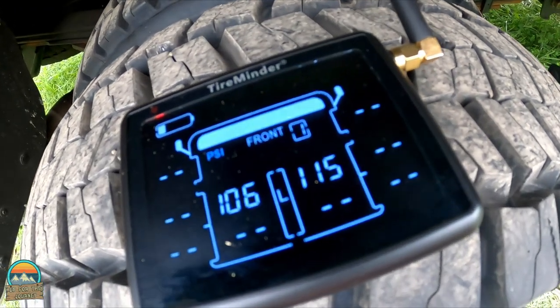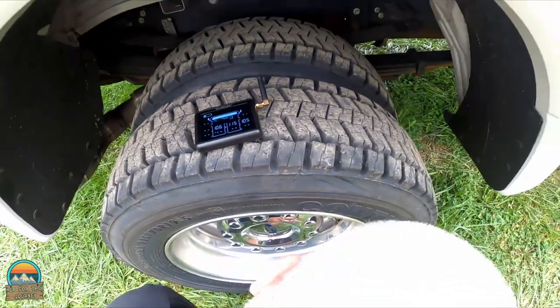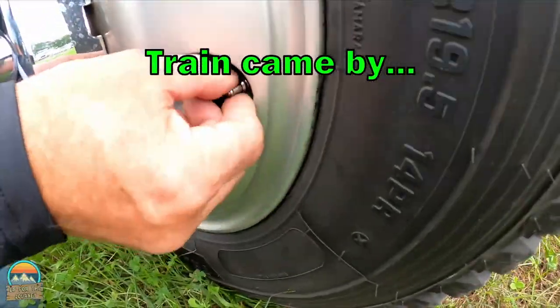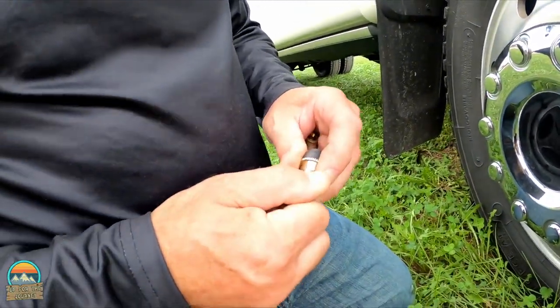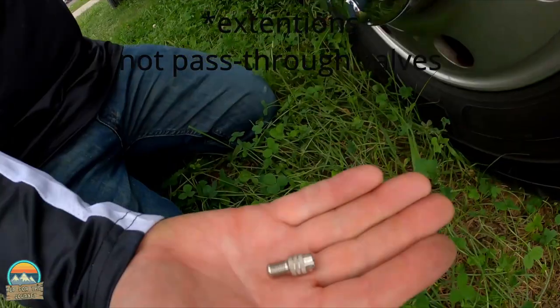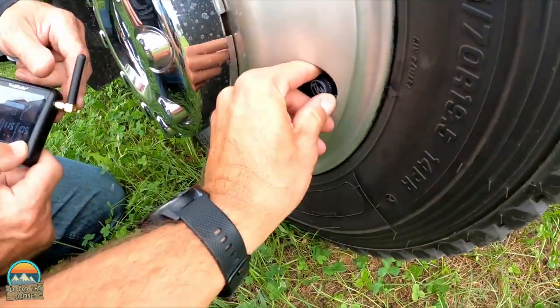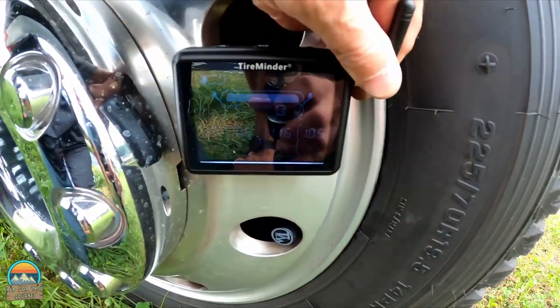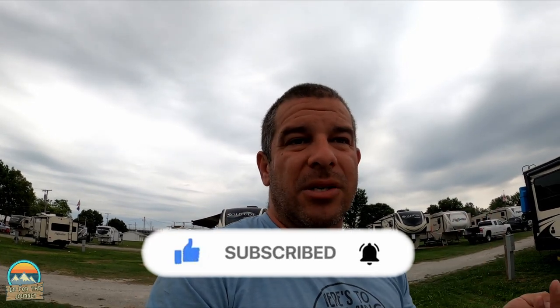We're on the front tires now — let's see what PSI we're at. 105 on that one, so the insides are really high. On the front there's also an extension, but the pass-through doesn't fit on that threading with the commercial tires — note to self, guys. But look how clean it sits without the extension. Michael made a good point: without the extension, if you hit a rock it's not going to take off the TPMS sensor, and it just looks cleaner. Guessing the PSI — 113. We are all over the board.